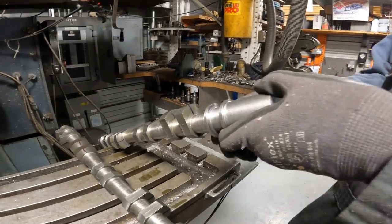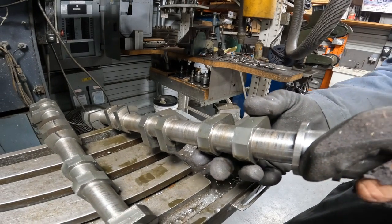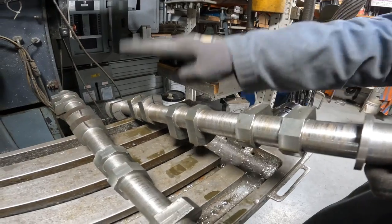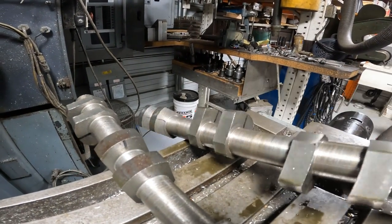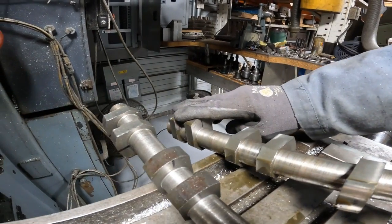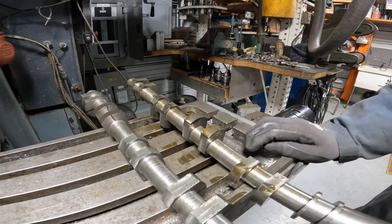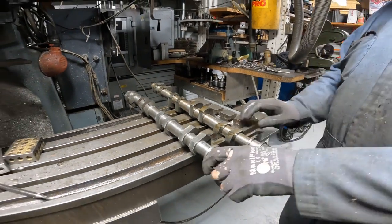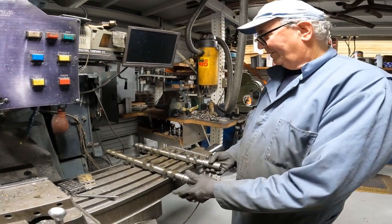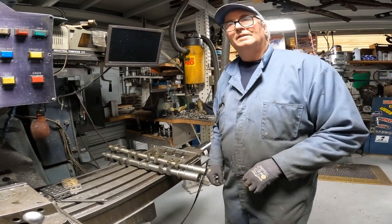So if you go through this — like this is number one, 90 degrees, which would be 180 of the crank, would be 90 degrees of the cam. This is number three. And then another 180 of the crank — 90 of the cam — that's four. And then another 180 of the crank or 90 of the cam is two. And because they're both — one's intake, one's exhaust — they're both the same order. The exhaust would be before the intake.